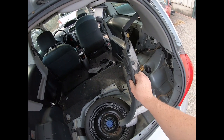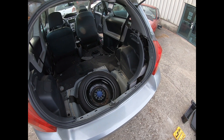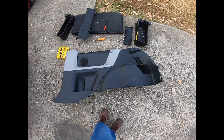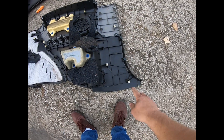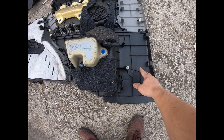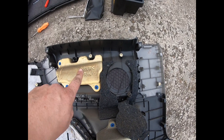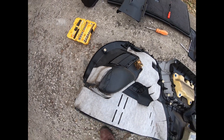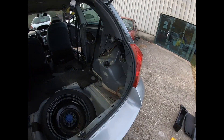Like I said, this job will be a lot easier if you remove your rear seat. I'll put that video in the description below. It's not super long and it will really make this a headache-free job. Here's a video of the panel out completely — I'll flip it over so you can see the back side and where the clips are. You've got two right down at the bottom by the front door, one in the middle, one near the top by the speaker, another near the top by the speaker, a couple in the middle gray panel section, and one in the rear. It is pretty simple.